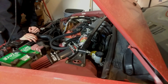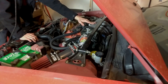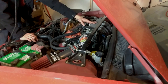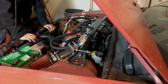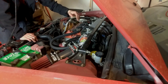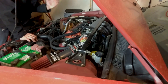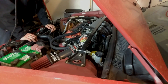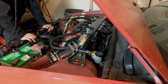Now with that heat shield installed, we can get to the last problem I'm going to talk about today, which is the butterfly screws found on the intake manifold of this car. One of the technologies implemented on this engine that's only found on the first generation QR motors is the dual-length intake manifold. This means that there is an actuator found near the intake manifold that at a certain RPM switches over to a new set of runners for the intake to add more horsepower at higher RPM. The downside, however, is that the screws that hold these flaps down get loose over time and when they inevitably fall out, they get digested by the engine, causing immediate death to the powertrain.